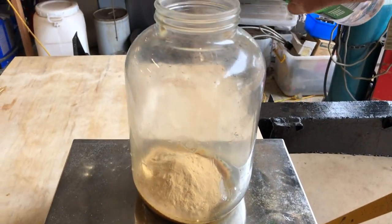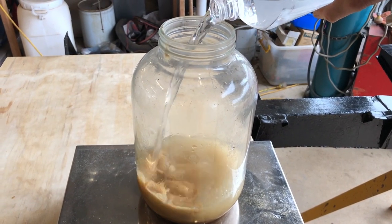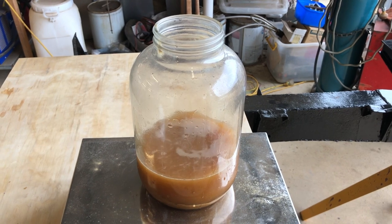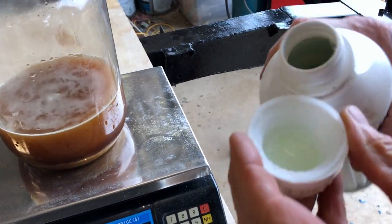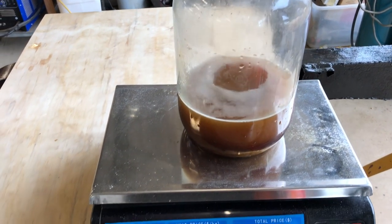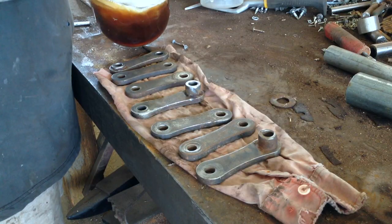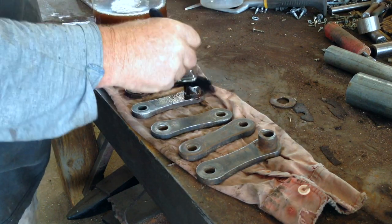So to that tannic acid powder we're going to add half a litre of methylated spirits, which is essentially ethanol. To the methylated spirits we're going to add 500 mls of water — essentially 50-50. The War Memorial in Canberra did a lot of research on this and found 50-50 to be the premium sort of blend. You actually want a little bit of flash rusting for tannic acid to react. Just to buffer that, because it is quite a strong acid and we don't want to etch the surface too much, we're going to add 2 mls of phosphoric acid — dilute phosphoric acid — so that's 1 to 100. I'll put the recipe for this in the description below.